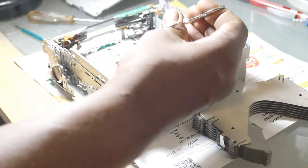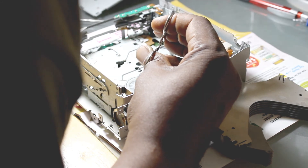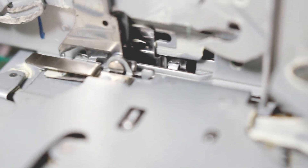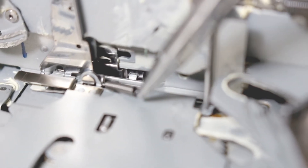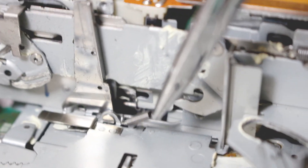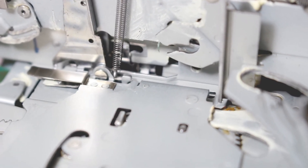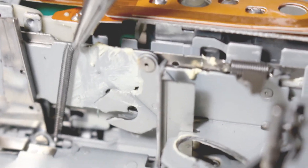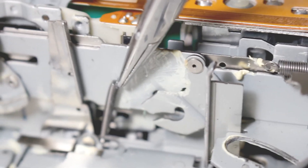With it all up and out, my spring is right here — just going to pick that up and put it back onto the wall. I've lost the other side of what it hooks onto, but based on the other side I can see what that hooks onto. So that little hook is what the end of the spring needs to connect to. I basically held onto the spring here, went underneath a little bit and up — and I did it. It holds on. And then I'm just going to put it back over on the wall to have it rest there for the rest of my assembly. That's the detail of how to get those springs in place.